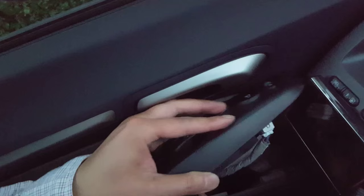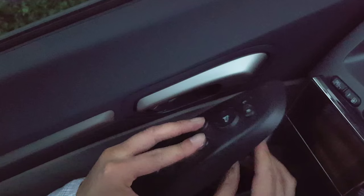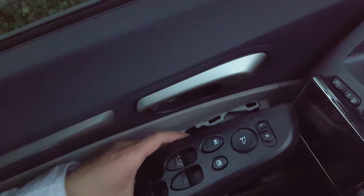Okay, now that we're back in the car with the unit, I'm just going to put it back in. You just make sure the car is off for now, and just plug in the first plug, make sure it snaps in, then plug in the gray one. You can't really see it, it's off frame, but plug in the second one, turn on the car, and try out your windows. Make sure that those things work. Before you push this thing back into the side panel of the window.